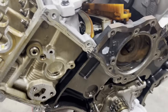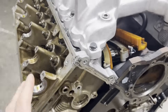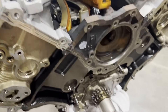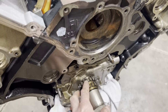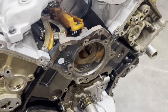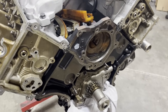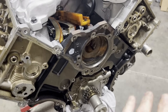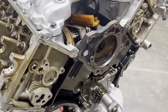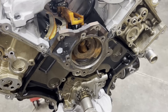Everything's in good shape. I've got some adjustable cam gears coming — Comp Cams adjustable gears — and I've also got a hardened gear for the crank. I'll probably go ahead and replace the front end with some good quality parts because I can reuse all of that on the next iteration, and I'll want some pretty beefy things for that iteration.